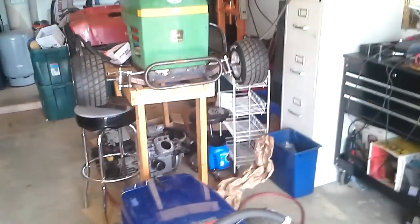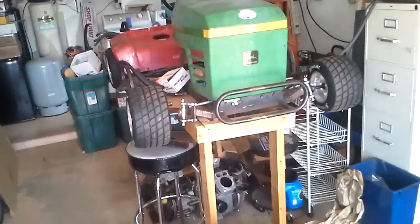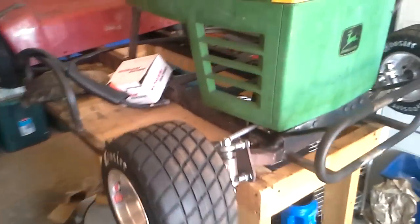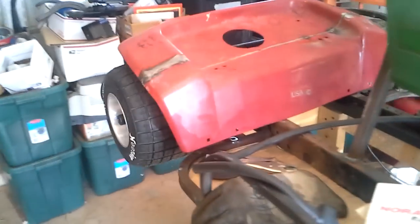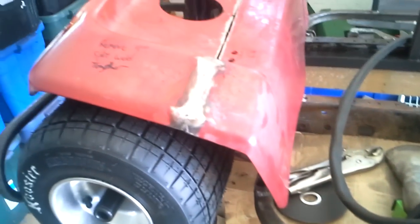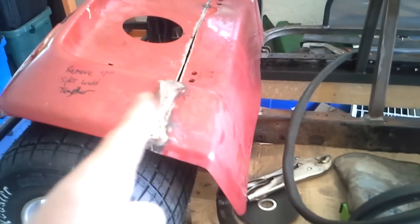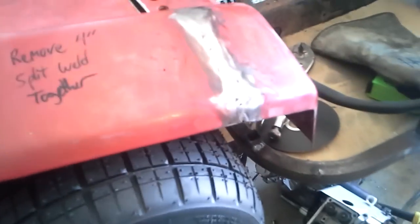We have this one — it's for a buddy of mine, getting into racing. It's basically a John Deere hood with Toro fenders. I cut down the middle and re-welded them. I took four inches out of the actual fenders, cut four inches out and brought the front back to the rear, and just stitch welded it.